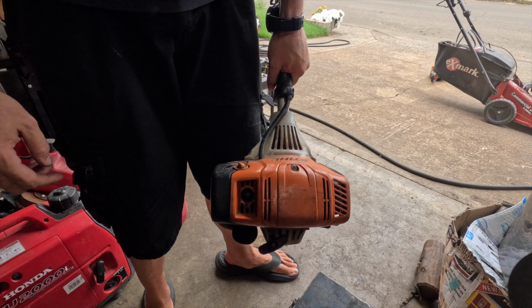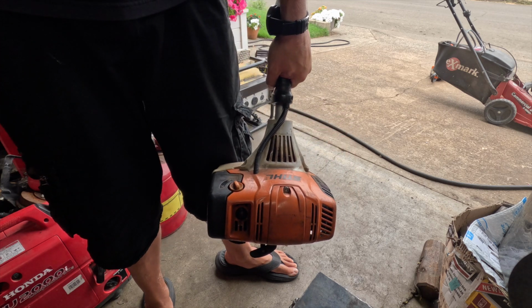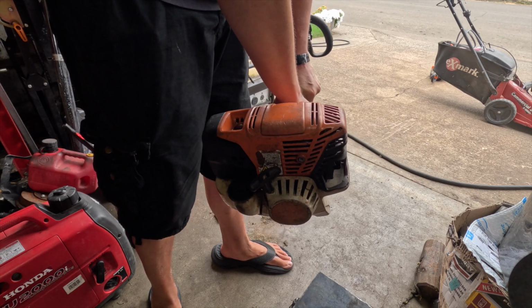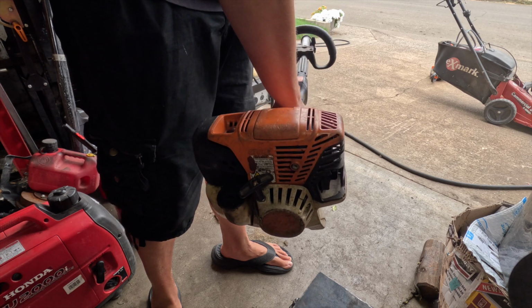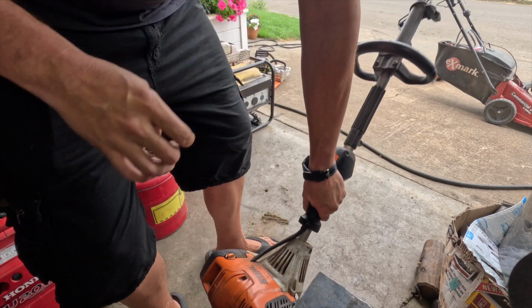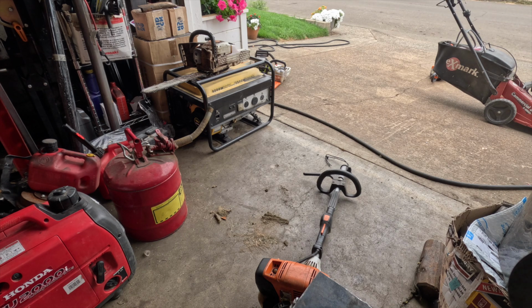So I'm going to probably play with the tuning a little bit, because I think over the course of time it kind of got out of tune in addition to that, but let's give it a try one more time. Yeah. I definitely need to tune it. The RPM ranges are a little high for my liking, but that's not part of the video. That's just because the idle's way too high, and kind of seems like it might be running a little lean to begin with. But that's not too uncommon when these get a little older. Kind of need to adjust them periodically.